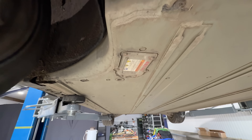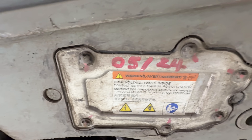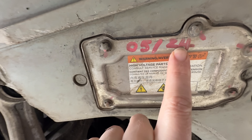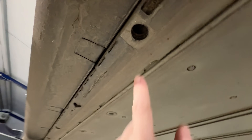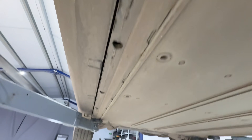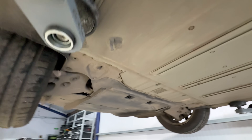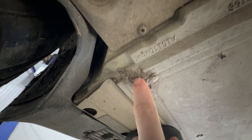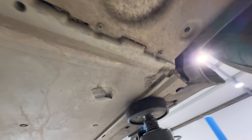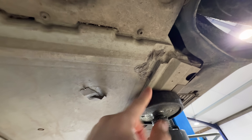The battery itself looks in fairly good condition. There's a number on there - 0524 - so it makes me think this has been off in 2024. That's where the fuse lives. I'm guessing that this pack has been dropped out or there's been some other high voltage work carried out on this car because they pulled that fuse out as a safety disconnect to allow them to work on some other high voltage systems. Looking at the battery bolts though, none of these look like they've been freshly removed, so I'd say the battery pack's definitely been left in the car even if the fuse had been taken out. There's also odd bits of sealant in weird places on the bottom of the battery pack - if someone could let me know in the comments what that's for, it seems to be on all these bits where you'd think there are weld points, so maybe just extra caution by Tesla.